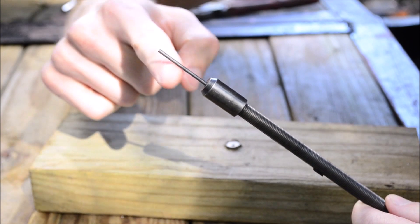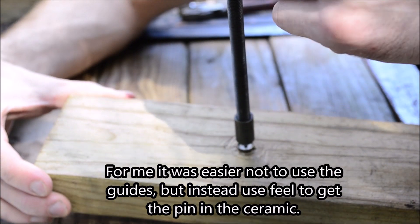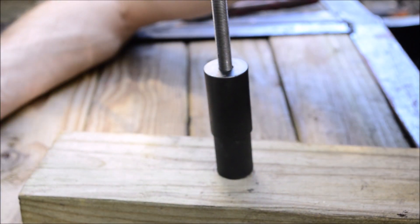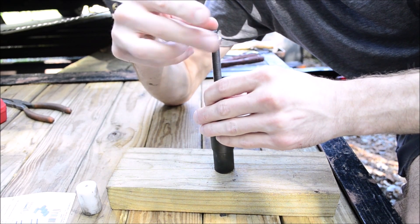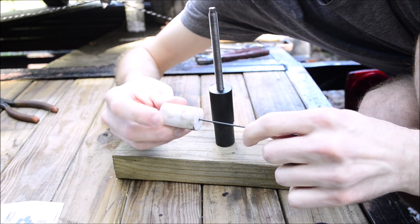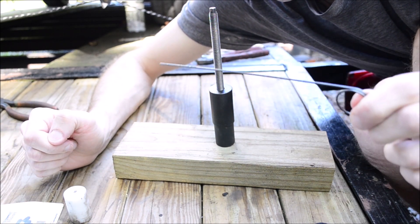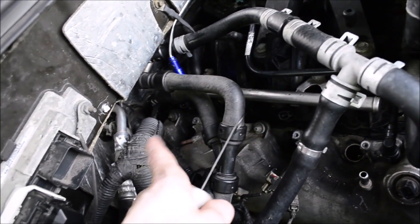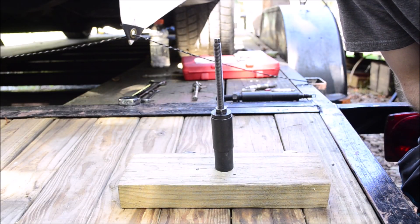Then apply some adhesive to the pin, get it down in there, spin it around, add the plastic guide, and let the glue cure for one hour. Put the washer on and get the nut ready so you're ready to go once the glue cures. A tip: I take the white plastic guide off and don't even bother with it — for me it was easier without it. This thing gets stuck in the spark plug holes and you need a vacuum to get it out. Also, do not get this adhesive on the spark plug threads inside the cylinder head.